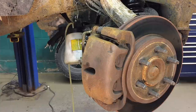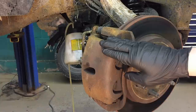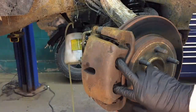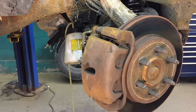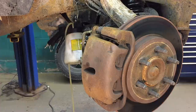Today I have a 2004 F-150 with a right front caliper that is seized up. The actual pistons inside the caliper are seized — not the pads or the caliper slide pins. These are pretty common, especially in bigger trucks like the F-150s and Super Duties. They go through a lot of heat cycles and are prone to seizing, whereas an Escape or a Taurus you may never see it for the life of the vehicle.